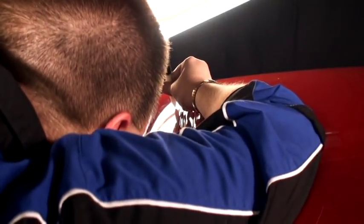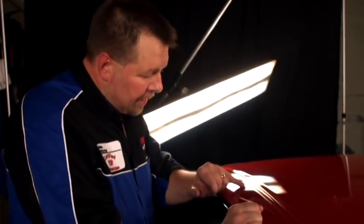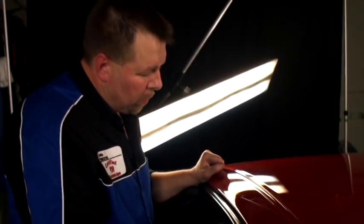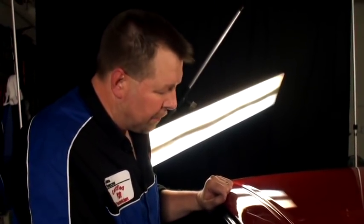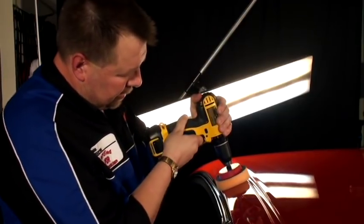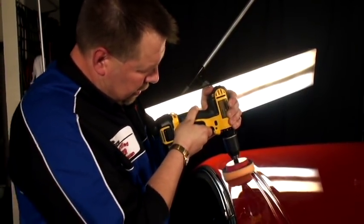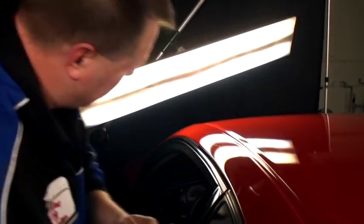That was a nice little sweat there. So what you're seeing left — the dent is flat itself. That little dark mark you're seeing is the chip, so just put some touch-up color back in there. Somebody had put some in here before, and then when we move to this dent, you'll see the touch-up in it too. So a little bit more cosmetically with some paint, and she is good to go. She's flat. And as a final little TLC here, I'm going to polish up any of the tap-down marks from my nylon tap-down. And there it is.